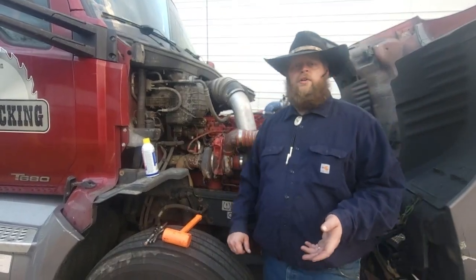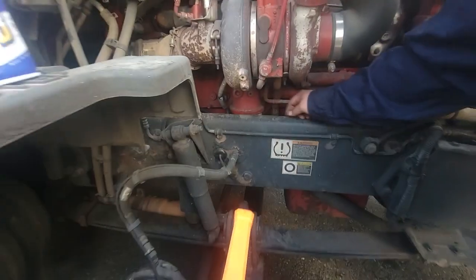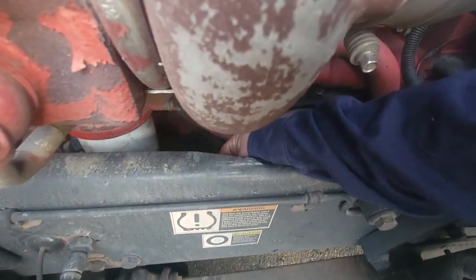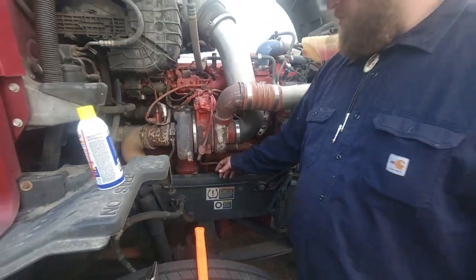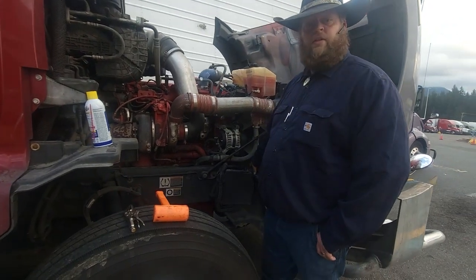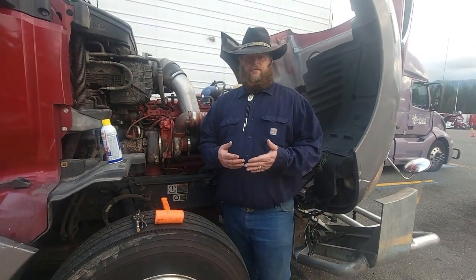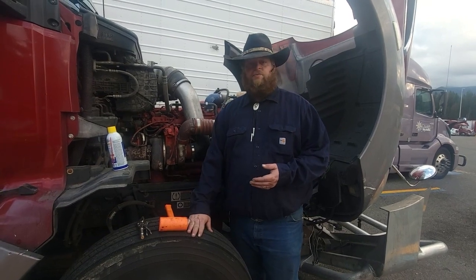They can get in between the push rods on your brake systems and get smashed, and all of a sudden you get an ABS light and don't know why. If you do get an ABS light, one of the common things to look for is these connectors — you just follow this ABS wire on the wiring harness. The wiring harness is located behind the frame rails and goes to the ABS module underneath the front bumper, all the way down underneath the center of the radiator. This ABS module works off a magnetic force and sends a signal telling you how fast the wheel is spinning.